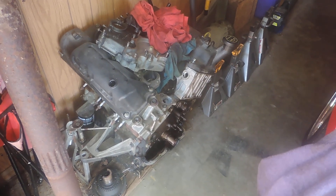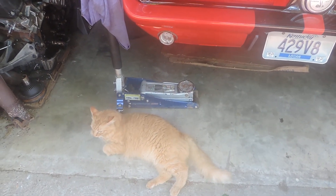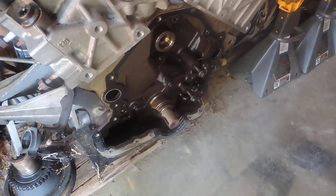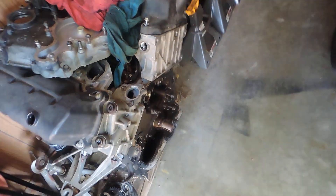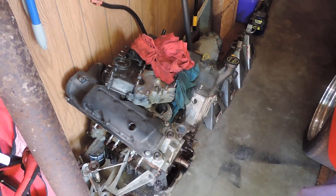This engine, being the 4.0, is a descendant of the German V6 that used to be a pushrod motor. It had a cam when it was a pushrod motor, so when they made it an overhead cam engine, they had a sprocket like a normal pushrod motor that would drive another sprocket — in this case, the jack shaft — which ran to the back of the motor and ran the timing chain on this side for this head. Another chain ran up to run the driver's side cylinder head in the front, and then yet another chain to run the pump and stuff like that.